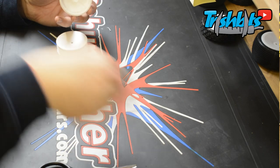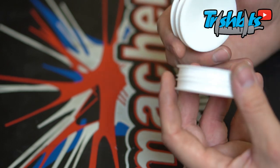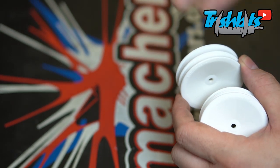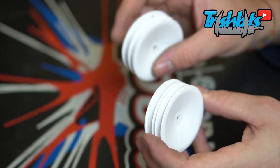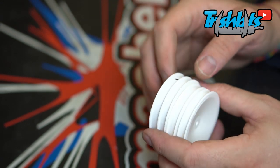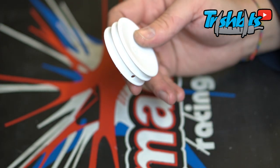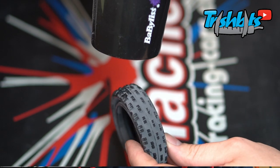What you'll find is the medium wheel is slightly larger in diameter, so it fits the tire a bit more tightly. The stagger when mounted will be more rounded on this wheel, whereas on the normal wheel it will be flatter — mainly due to the fact that this one is slightly taller and narrower when it's cut. But it will do the job and get you by.